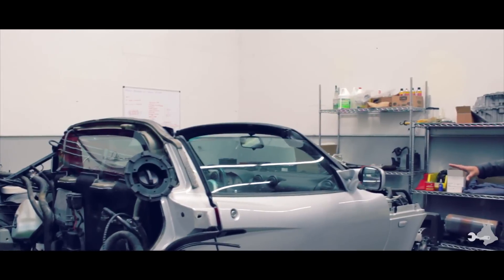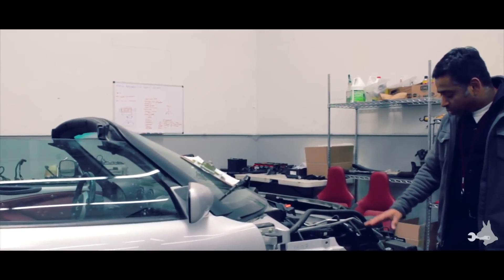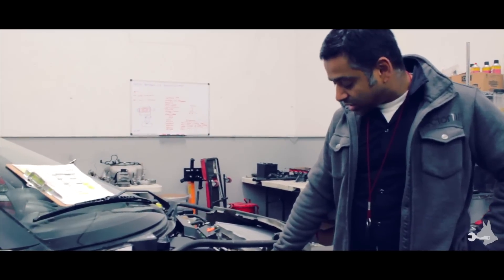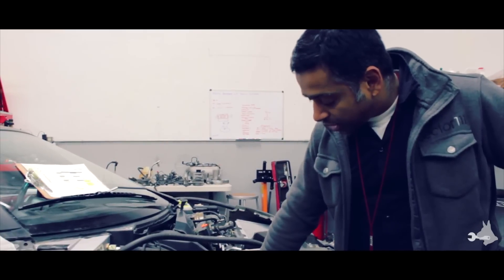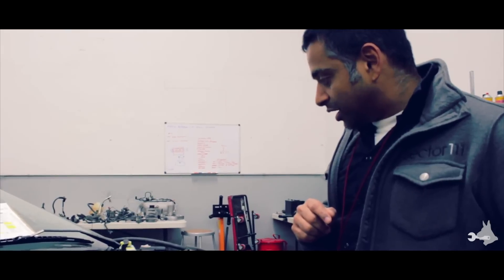The team has taken care of several upgrades on the front of the car: a new triple-pass all-aluminum radiator, new silicone hoses, and the wishbones — with all the stock bushes pushed out and spherical bearings installed. It's getting single-adjustable Nitron shocks, our steering arms, and a quicker-ratio steering rack. The client had previously fitted our two-piece front rotors, saving a bunch of unsprung weight, and we've just installed bullet studs. It's going to get our Katana 2 supercharger, making it a really quick, really good car when we're done.